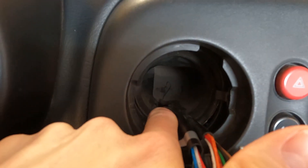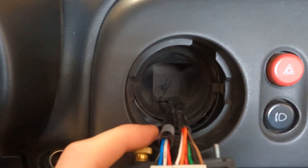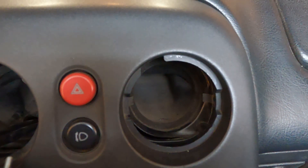The tube material isn't thick so it punches through pretty easily. I don't really need heat from the center vents — there are vents on the side and I mainly just need the defrost on the windshield. After further investigation behind the dash, I'd have to pull off half the dash to disconnect those tubes, so instead we'll just pop a hole in the bottom big enough for the vacuum line and two wires to pass through.